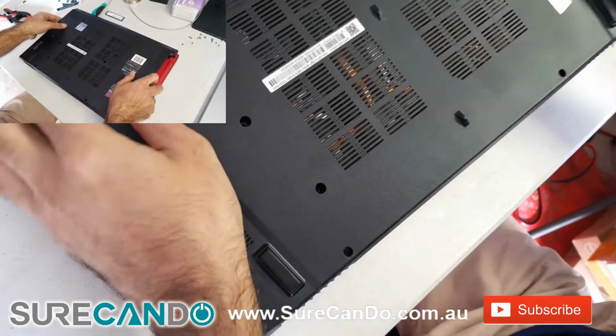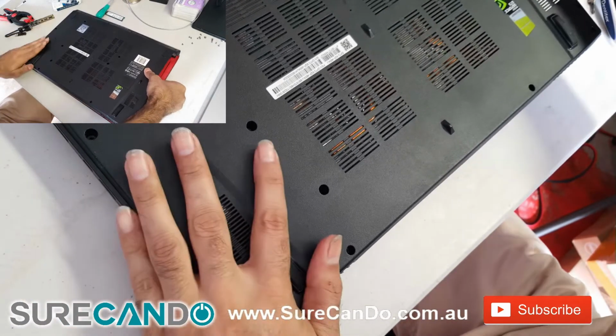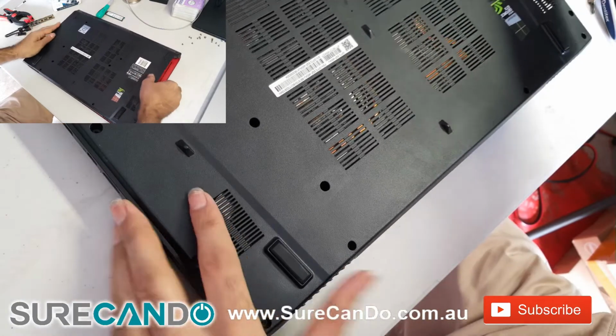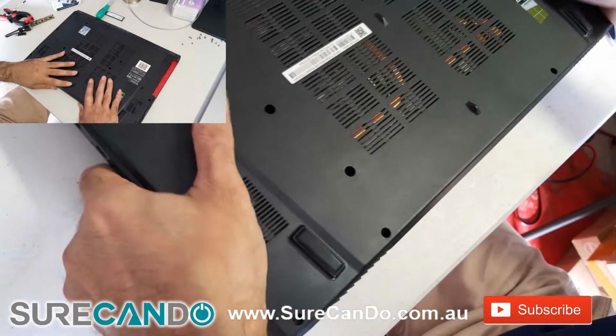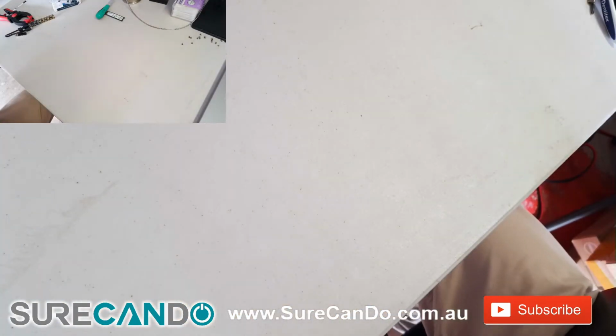Put the left side in first firmly, make sure all the ports are sticking out properly, and then gently start putting it down towards the right and make sure every clip clips in. And don't put any screws yet. Do a test, see if it's detected in the BIOS first, otherwise you'll have to disassemble again.